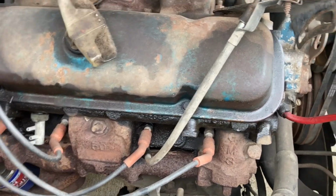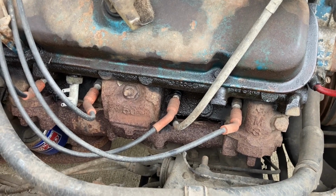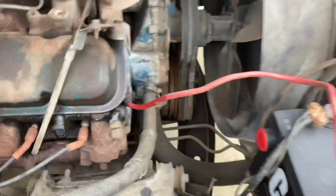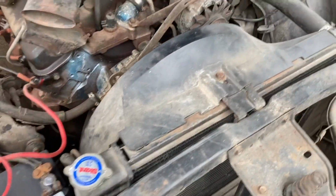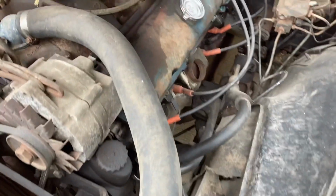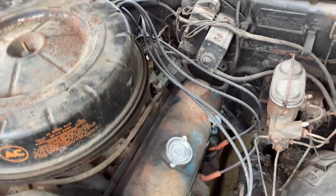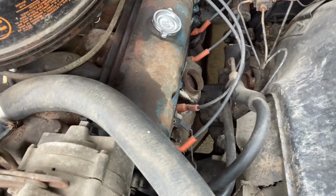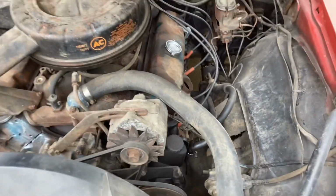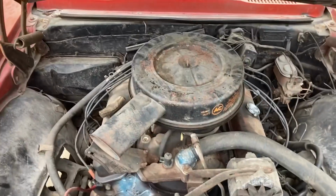It has 5 bolt holes for the engine mount, so that tells me it's a 1970 to 76 engine block. So that fits the 1975, and even the number of steps on the front here tells me it's 1975. So that's the, I would say, not so good news about the engine. 1975 was probably one of the lowest performing years because of emissions. But the good news is, it starts right up, doesn't smoke, doesn't knock. So the engine's probably gonna stay in this car.